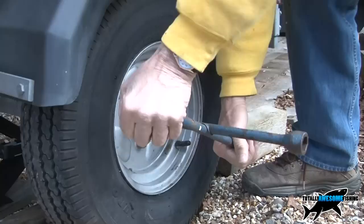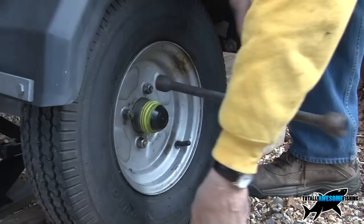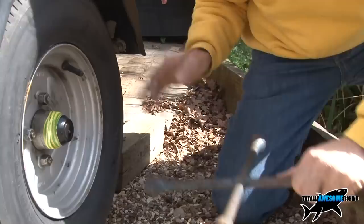Okay, let's get cracking. Let's get that wheel off. Here's the tip: when you have a trailer up on jacks, just lower it down a bit so that the tyre's got some grip, and just crack the nuts a quarter turn — just ensure you've cracked them loose with the tyre on the ground. Then jack it up, drop it on the axle stands, and you can take the whole wheel off with no problems at all.